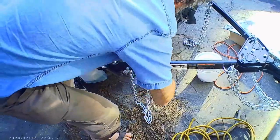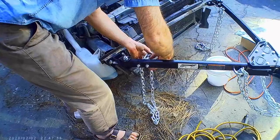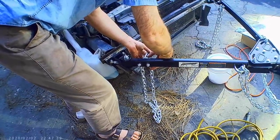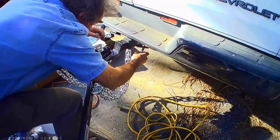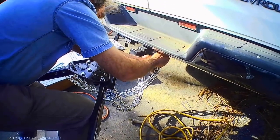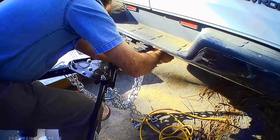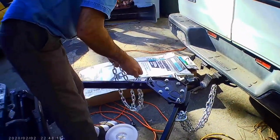You have to leave the wheels free, the key in the ignition, the transmission in neutral, and it on accessory. You don't leave it in the mode where the ignition is more in the on position — just in the accessory position. This shows the cross-hatching of the chains. You want to do that because in case it does come unhitched, at least it will be caught in the chains.